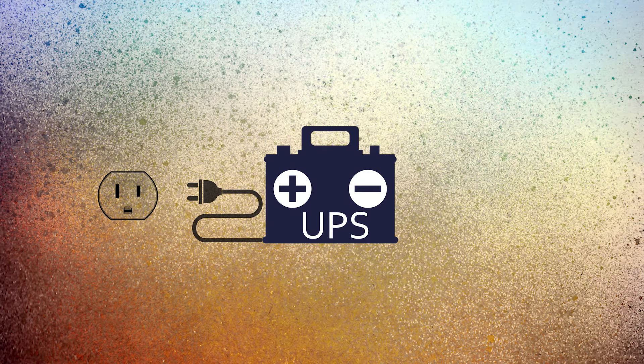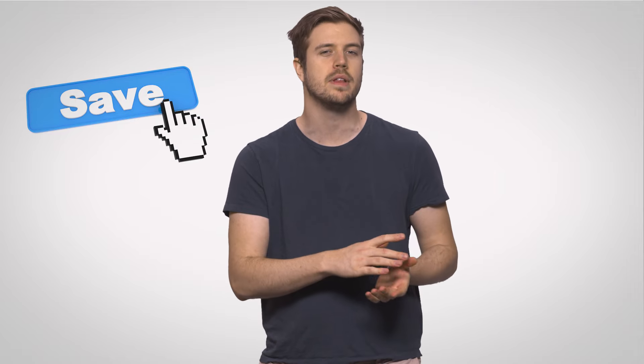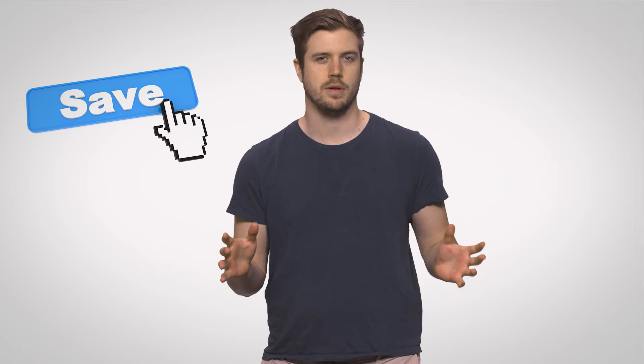There are many different kinds of UPSs on the market with different internal workings, but the basic principle of operation they all share is this: you plug your UPS into the wall, and then you plug whatever you're using — computer, monitor, server rack, or whatever — into the UPS, kind of like you would a power strip or surge protector. The UPS has an internal battery that gets charged from the wall, so if the power goes out, your UPS can keep your stuff running. Keep in mind, however, that UPSs designed for and affordable enough for home use won't keep your PC running for hours on end during a blackout. They're designed to give you enough time to save your work and shut down your computer properly so you don't lose anything important.